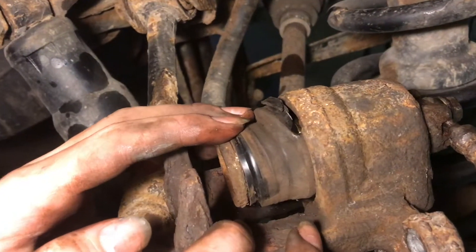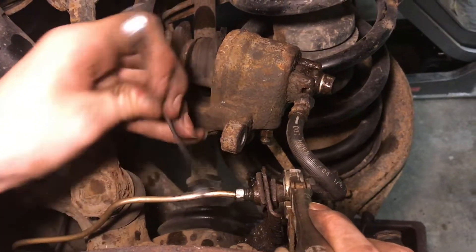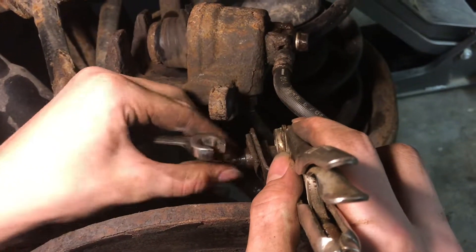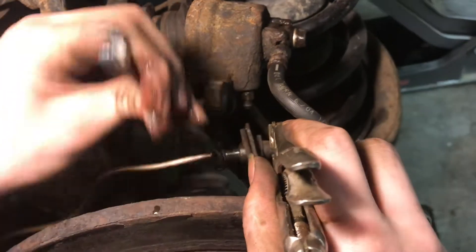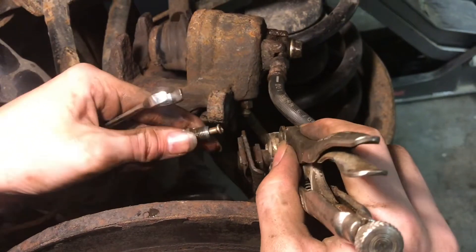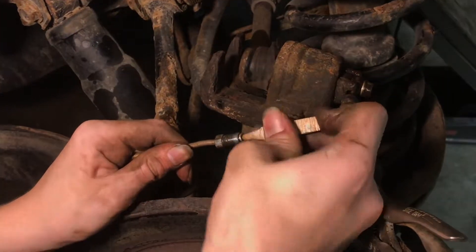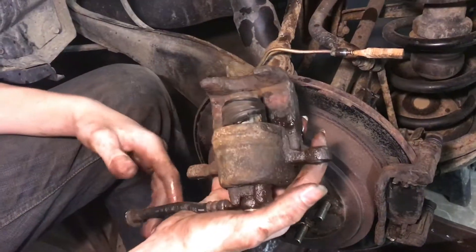This is as far out as the piston will go — it's starting to leak a little bit, and hopefully this is far enough where we can wiggle it out. We'll go ahead and disconnect the brake line once we get this out. I want to cap it to make sure we don't drain the entire master cylinder, because if we drain it of brake fluid we could get air introduced into the system. I've got a piece of wood to plug this hole — you can also use a pencil — and that'll keep all the brake fluid from leaking out.